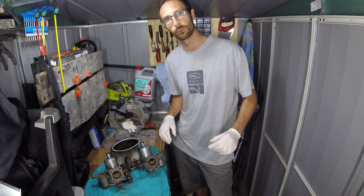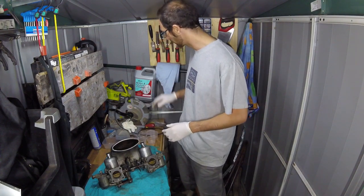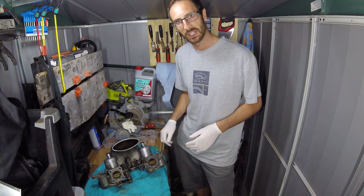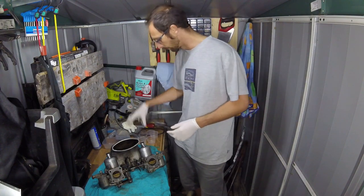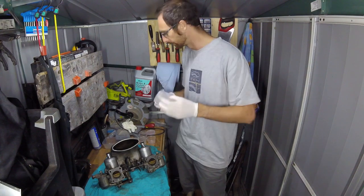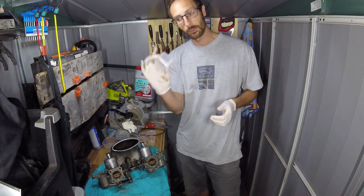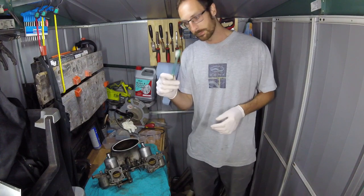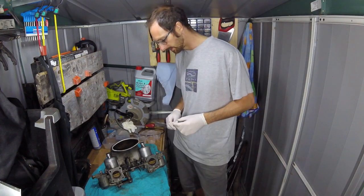Obviously you've got all the normal screws, screwdrivers, spanners, all that sort of stuff to take them apart. I haven't got a carb cleaner, but it's just a decoking, degreasing agent - brake cleaner will probably do us just fine. Loads of old rag, of course we've got our old socks. I've also got loads of little takeaway containers - these are awesome, the ones they deliver the Poppadom dips in. Just a handy little container, comes with a lid if we need to store it for a while. Super handy. I've also got an old toothbrush just for getting in there and scrubbing off all the horrible manky stuff this guy is absolutely covered in.